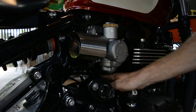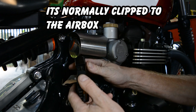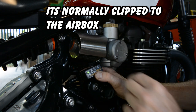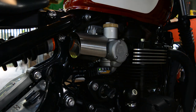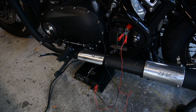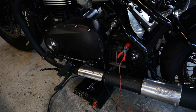So this here is where the OBD2 plug is on the Triumph Bobber — it's just tucked under here. For most bikes it's going to be under the seat. I just plug my OBD2 connector into it — this is my Bluetooth interface and that little blue light is flashing saying it wants to pair. It's also a good idea to have a battery charger on when you're doing all this, so that when you're flashing the ECU the battery doesn't go flat. If you're flashing the ECU and the battery goes flat you'll have a half-flashed ECU and it won't work.